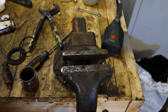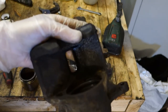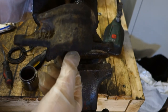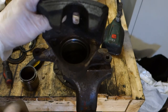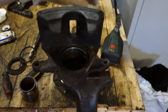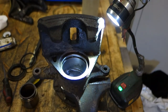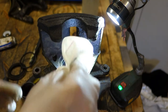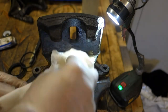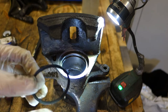And then use the kind of workbench that I have, because it is so easy to insert the brake caliper in here, and carefully press on that area, not this area. It is really easy to assemble when this brake caliper is in that position, and then use extra light so that we can see inside. First I take clean cotton cloth again, and I take all extra things in here away. This cleaning is a must. And now note, there is no lubricant yet, but soon I will add.